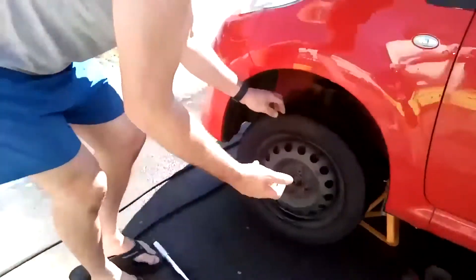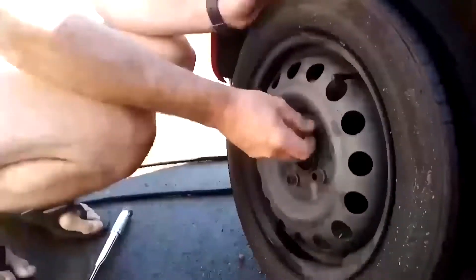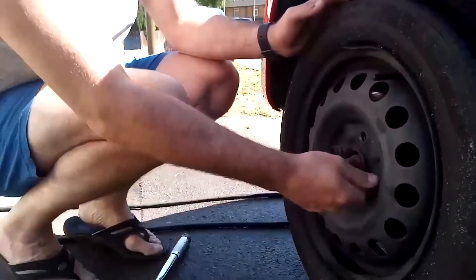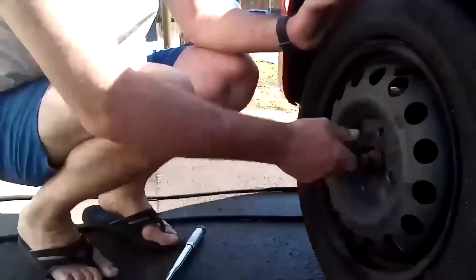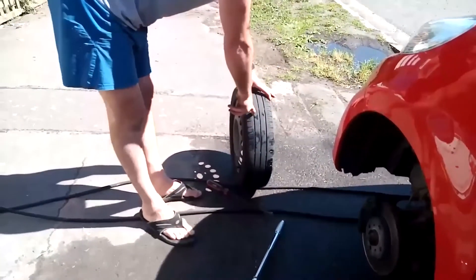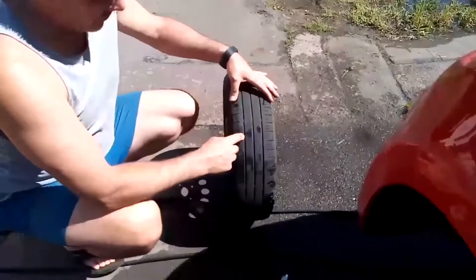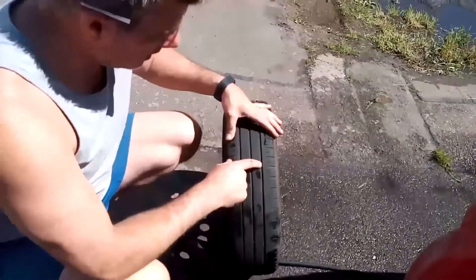What we're going to do next is take the wheel off. Because I've already loosened the nuts, I can just do them by hand. If you've got a tray, put them in your tray so you don't lose them. Once all the nuts are off, we can then actually remove the wheel — slide it to the side. When it's off, we're going to check the tyre tread depth, which should be 1.6mm minimum by law. Anything lower than 1.6mm is illegal to drive. These are about 4 or 5mm deep.